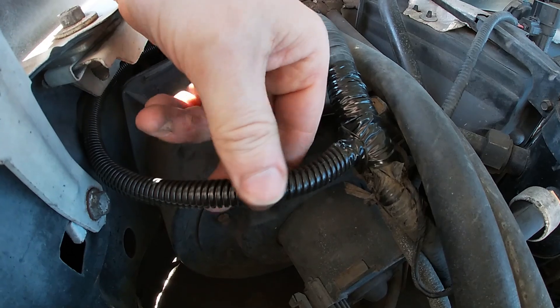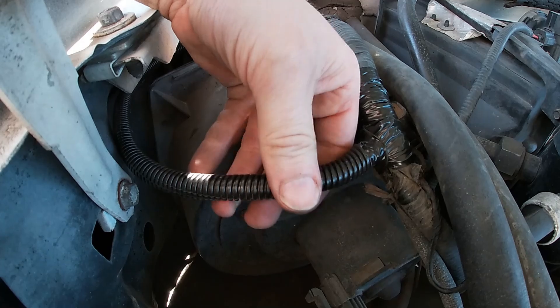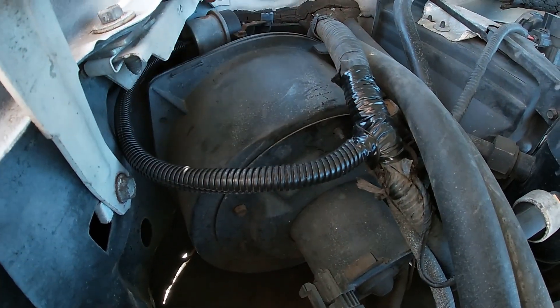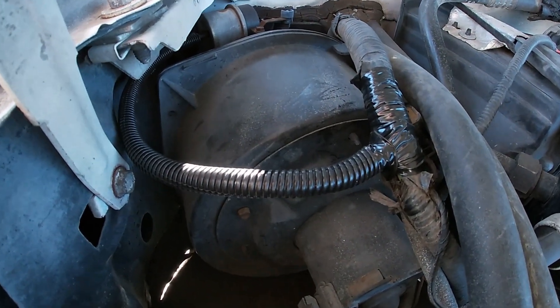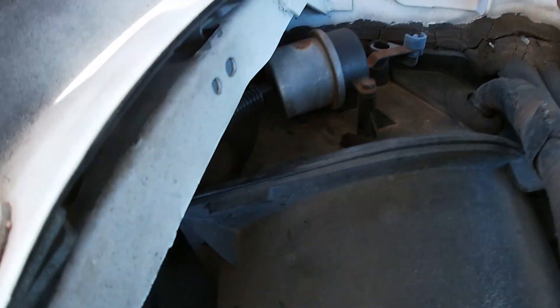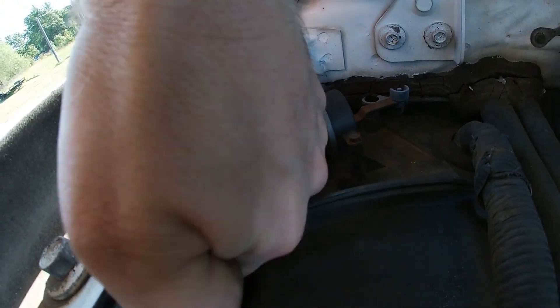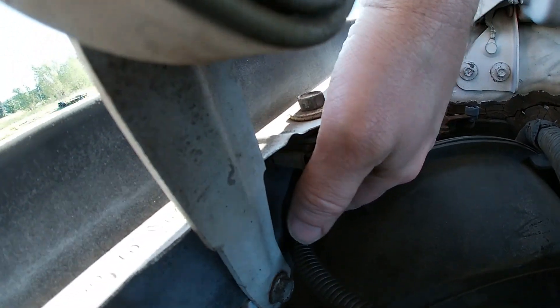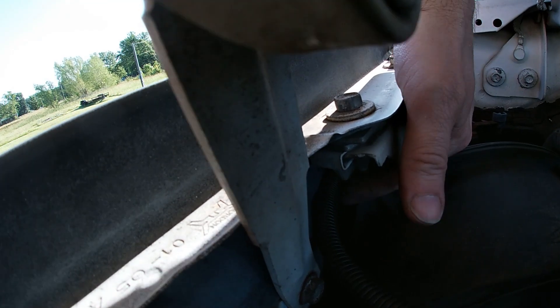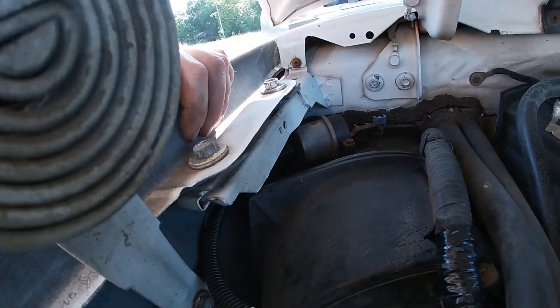Also put some convoluted tubing over that hose — that's just what I had laying around. You can use a little bit smaller piece, but it covers it to keep the same thing from happening again, which is just rotting. And it goes all the way up back to this, which is real fun to try to get your hand down in there. Because they gave you so much room — it's a big pickup, and they gave you room to work. Thanks Ford.